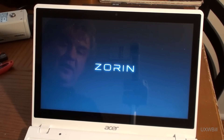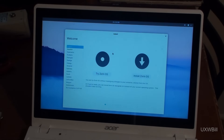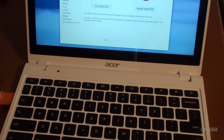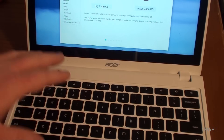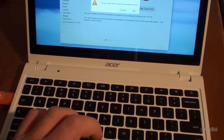One operating system you could run — although I think it's slumbering and isn't in especially active development right now — is known as Gallium OS. Gallium OS is a Linux distribution that caters to people who are doing this sort of conversion with their Chromebooks. I don't think it's had an update since late 2019 or thereabouts. It sets up the keys so they function with the functions indicated on them. Most Linux distributions are going to treat these as standard function keys.